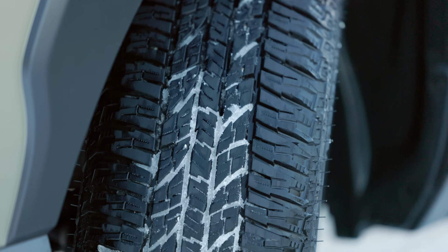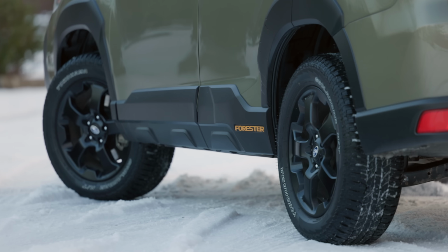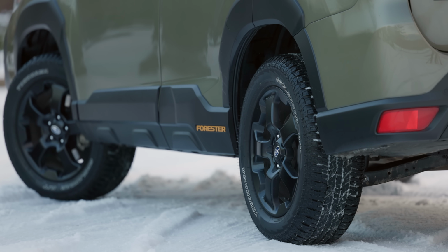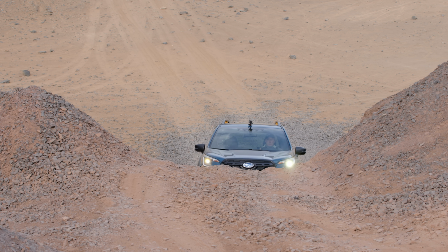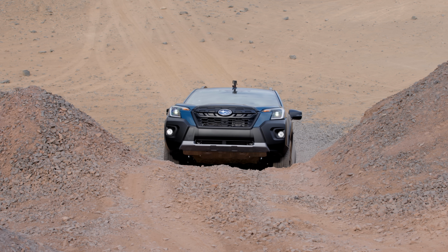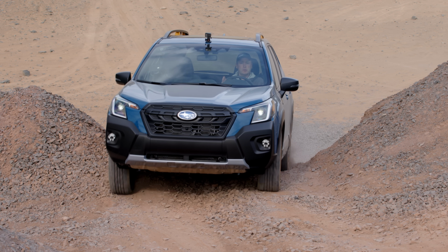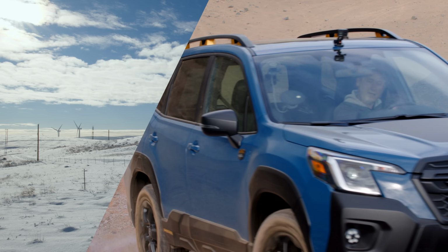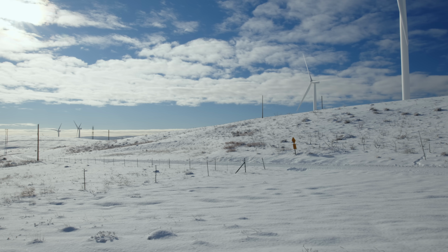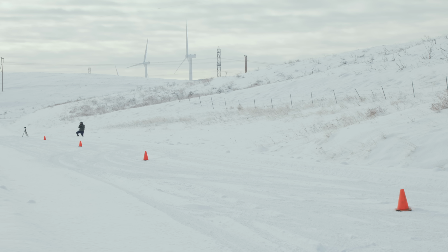The Subaru comes standard with snow-rated Yokohama Geolandar all-terrain tires, 9.2 inches of ground clearance, and symmetrical all-wheel drive with dual-function X-Mode. Like the Compass, this also uses brakes to control power distribution, along with special programs to control the amount of slip allowed. The only transmission option in the Subaru is a CVT. Our first test is with the Compass on a deserted road, covered in compacted snow, where we've laid out a slalom to see just how the various drive modes respond.